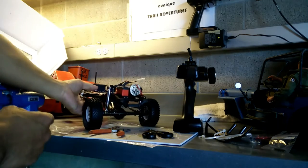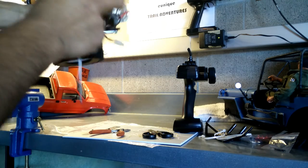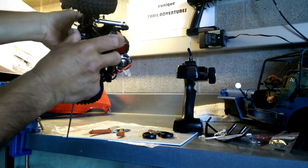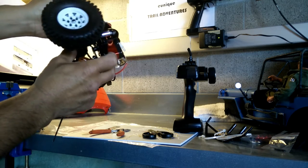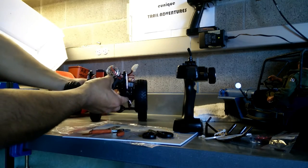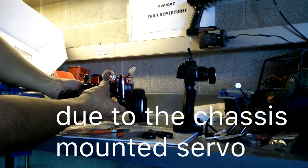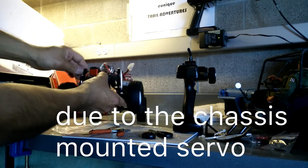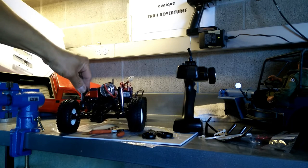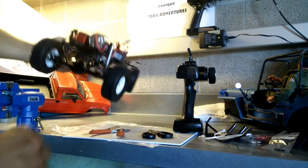It's funny, I just saw something that I might be able to use. Smaller shocks. The shocks look a little stiff, or the springs, sorry, the leaf springs. I might be able to modify that by removing some of those leaves. So, see here, as I'm compressing and the wheels are turning slightly, that's bump steer. I have to figure out a way to eliminate a little bit of that. Since the leaf springs are a little stiff, I might have to remove some of these leaves. Maybe. Well, that's an option.